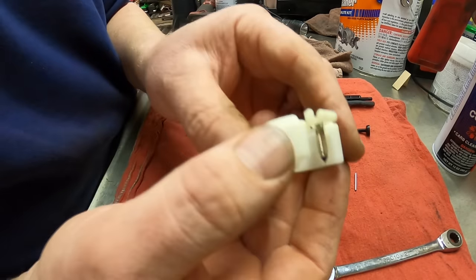Tight, all right. Now, sometimes your needle will fall off your float, so the spring goes in between the float and the needle like it is. Wipe this all off so it's ready to go. What I like to do is take the float rod and put it in there about that far, and then you can put this in and hold it and put the float rod in. So there's that.